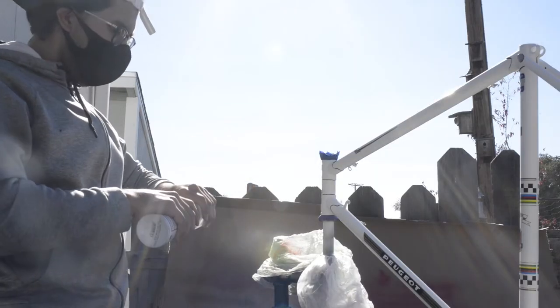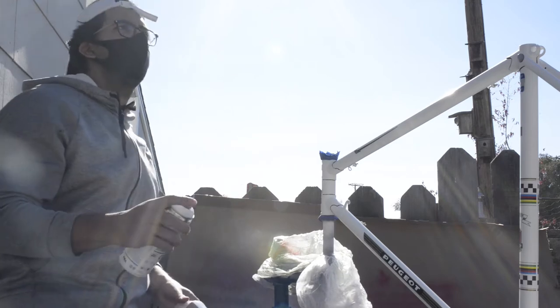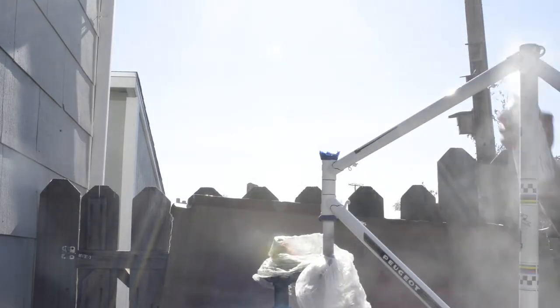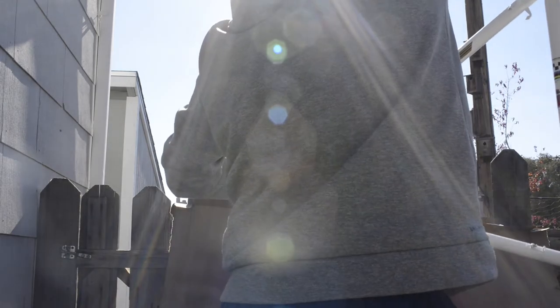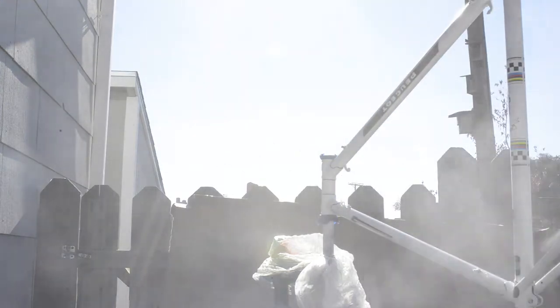Alright, so I got the bike frame now. Going to do the same thing — just really lightly over, give it a flip upside down, and yeah, let it dry for about two hours. Give it a little sand and then we'll apply a second coat. I always get a little bit nervous before. Now we'll flip it over — my trick is to just grab it from the bottom bracket and the top. I just hope for the best, really. Quick flip and get it back down.